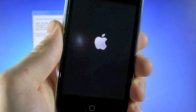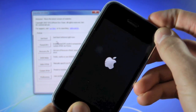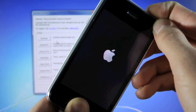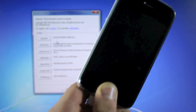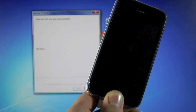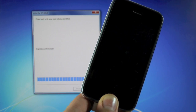Once done, you'll know because you'll be stuck at the Apple logo. Remember, this is a tethered jailbreak, so now we have to go into RedSnow, hold power and home for 10 seconds, then let go of the power button and keep holding the home button. Select 'Just Boot Tethered' and click next. Once it recognizes your iPhone, it'll put it into tethered DFU mode. Wait about two minutes and it will complete the tether boot.